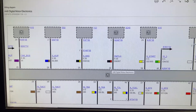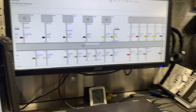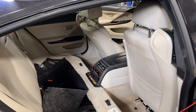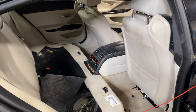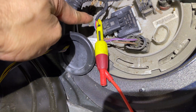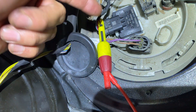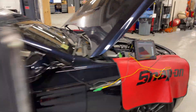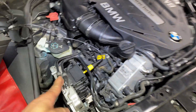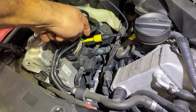I did a jumper wire because I checked for continuity — there's no continuity. I now need to find out where the wire is broken. What I did in order to clear the code and make sure that everything else is working good, I just went over the cable. Here's the five-pin connector — it's the black and red. So I pierce the wire and put electrical liquid tape to close the hole. Then I put a jumper wire all the way up to the front. This vehicle has two DMEs. On the passenger side, it will be the third connector down and pin 37, which is also black and red.